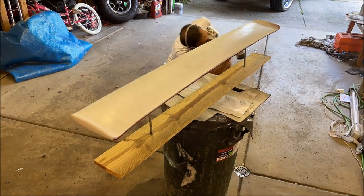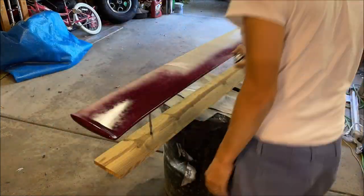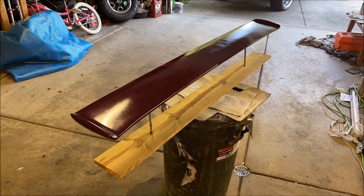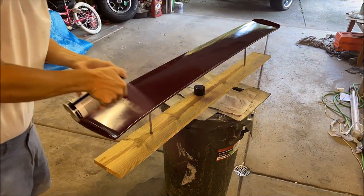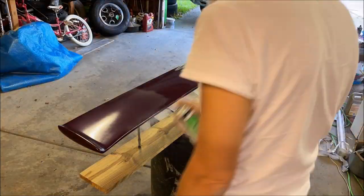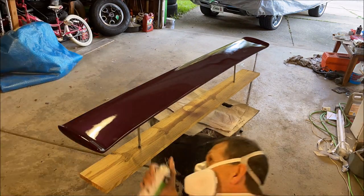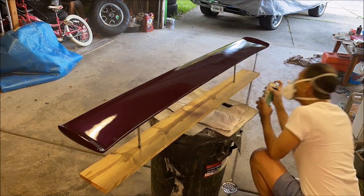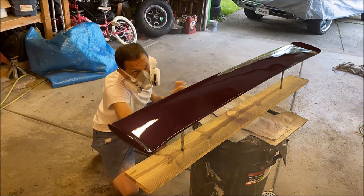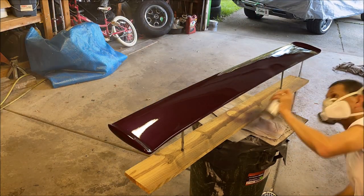Now here's actually painting it. Cleaned it off with AcryloClean and stood it up. I put studs into two pieces of brake tubing, then screwed the tubing into wood to hold it up in the air, trying to do the bottom first. The top is the most important part, so right or wrong, that's the way I did it. The paint is from A.L. Pavey's on Promway Avenue in North Canton, Ohio — a paint specialty shop. They actually scanned my car and came up with a paint mix based on scanning the paint. This color came out being called Cranberry — it's actually a Hyundai color.